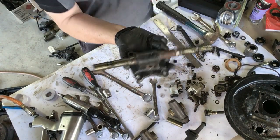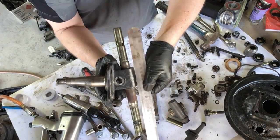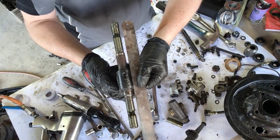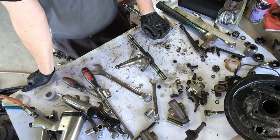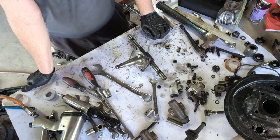And then we've got the kingpin. I'm not taking the kingpin out. I've had a look at him. He's nice and straight. Oh, hang on. Nice and straight that way, and that way as well. Just like the other one. So all I'm going to do now is just give that a clean up all the parts, re-kit the wheel cylinders, give the brake drum a good clean up inside, get rid of all that rust, paint it inside, obviously except for where the actual brake shoes run. Replace a few hoses here and there, and put it all back together.